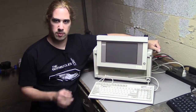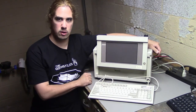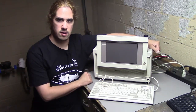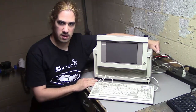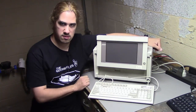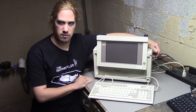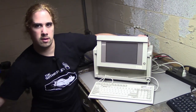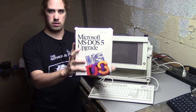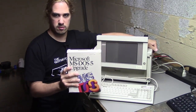I think that'll finish up this episode on this computer. Still a bit of work to be done — still need to try to repair the built-in keyboard and replace the wire. Still need to get a battery for it, because every time I unplug it, it forgets all its diagnostic settings, which screws up XT-IDE. It works perfectly fine when the settings are saved, but when they're not, I need to boot without the compact flash card, run the diagnostic floppy, save the settings, turn the machine off, put the compact flash card back in, and then it works fine. One more upgrade: in the next episode we're going to see if we can get DOS 5 installed overtop the version of DOS 3. Thanks for watching, and stay tuned for the next one.